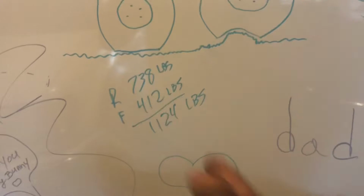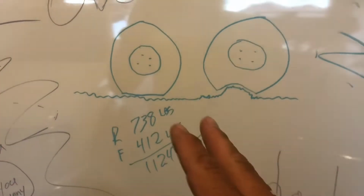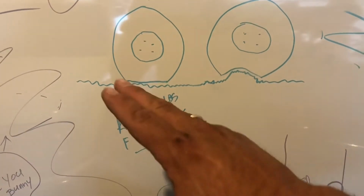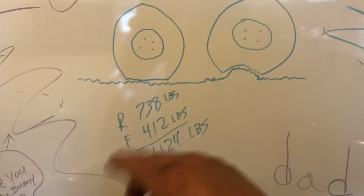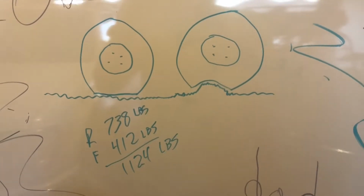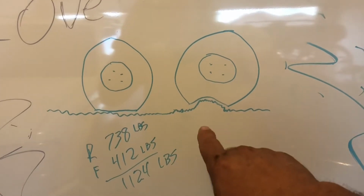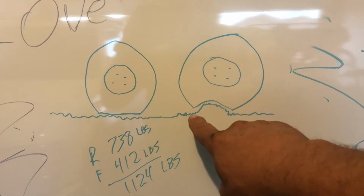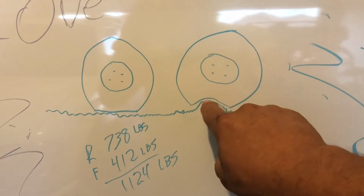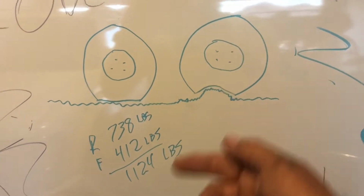Now, there are some other factors of the weight, distributing this way and then curving and all that. Well, I'm not going to try to figure all that out. That's way beyond what I care to do. But you can just figure that when I get into a 30-40% incline, I probably have 1,000 pounds, maybe 950 on my back tires. As I go down the trail, my tire's like this, and it doesn't hurt it at all. But when I get on a rock, it now pushes up over the rock and squishes over it, and my contact point gets closer to 15 or even maybe 18 inches of tire by 10 inches wide grabbing at one